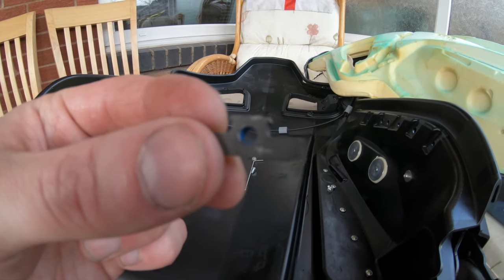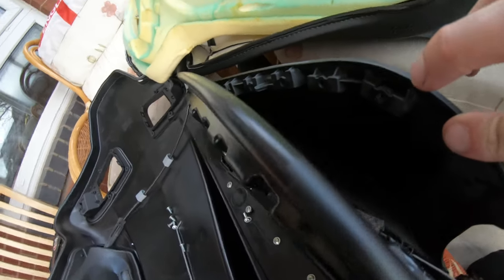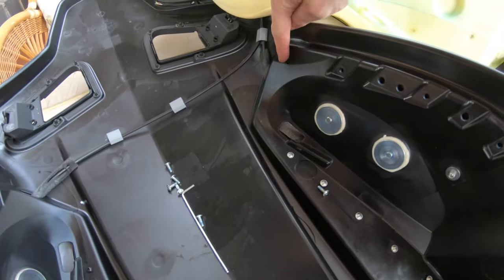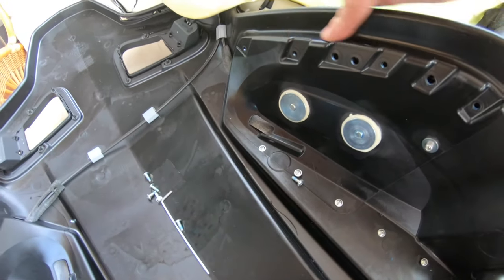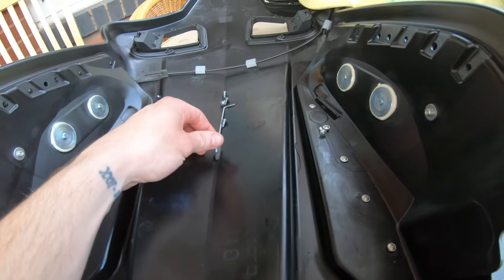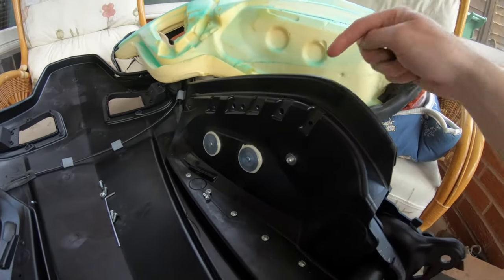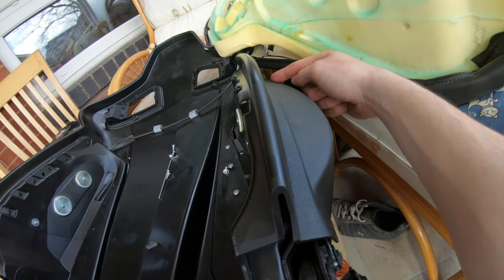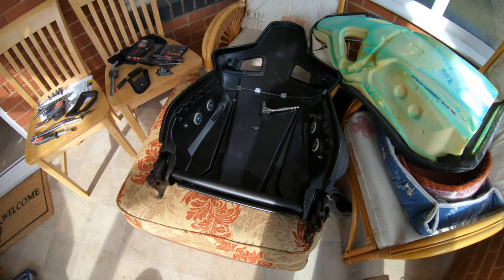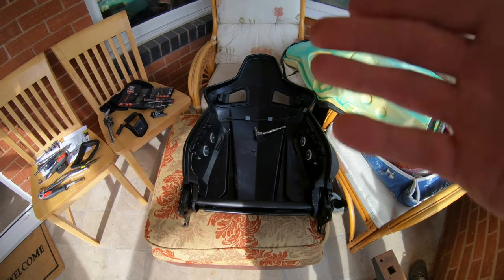If you get any of those small inserts drop out, inside the top rows — six across the top — they are what give you the thread inside the plastic trim for the screw to screw into. They push up into the trim. When they drop out, look for the ones that are missing and push them back in. Then basically reverse the procedure we've just done and build it back up.